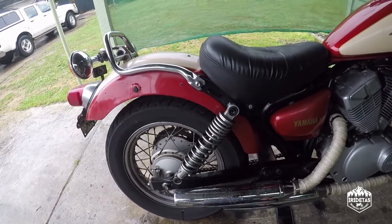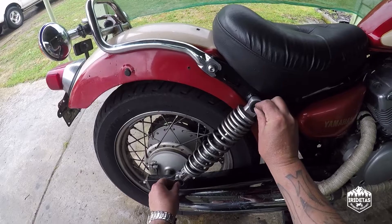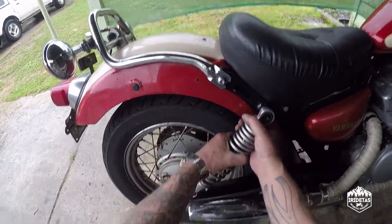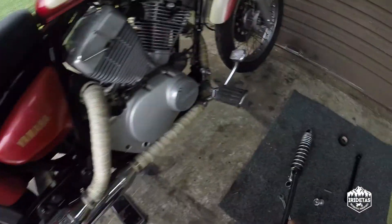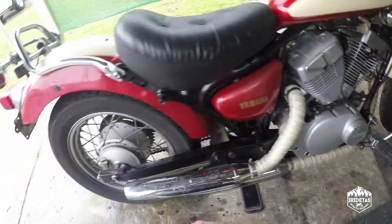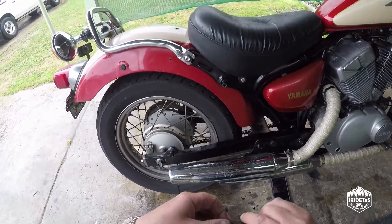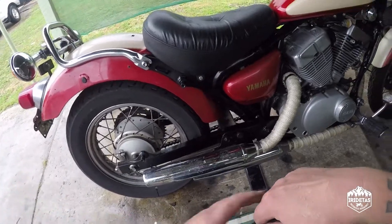Carport's leaking as you can see, but who cares? You take those bolts off — they're 10 mil — and that gives you access to the shock. Literally that's as easy as it is. There's the strut, you can see there's just a little bit of play, so we'll just wrap a couple of rounds of electrical tape around that to just take that play out of it.